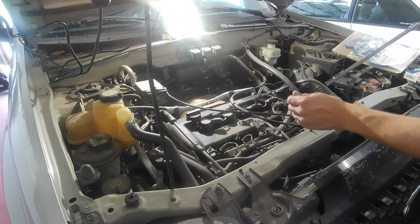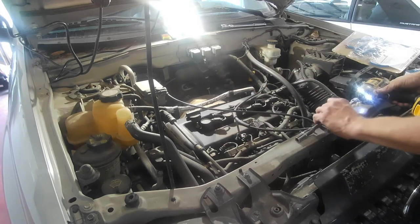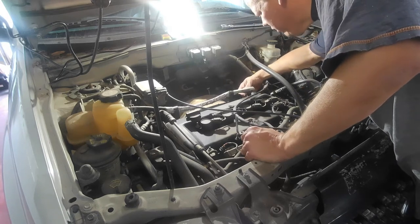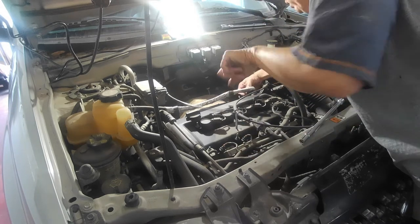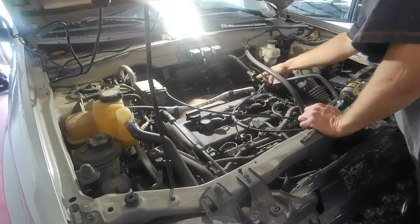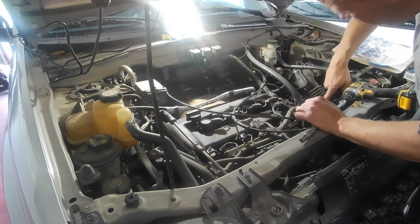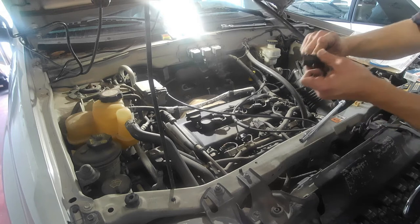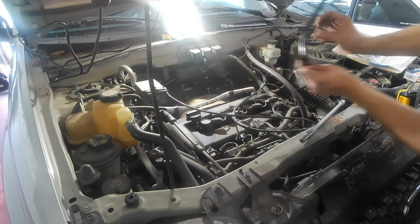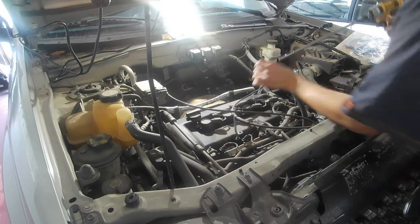This throttle cable is right in the road — that's handy, it's loose. These here just have a little spring clip on the bottom; just move it over and pull it straight off. I'm going to remove this one to show you — you just move that over and you can pull these straight off pretty easy.